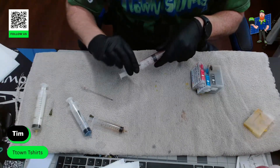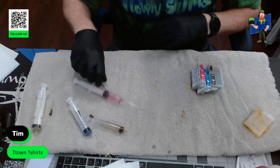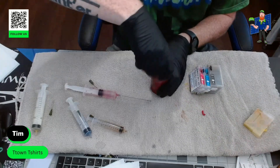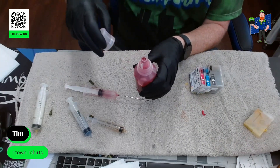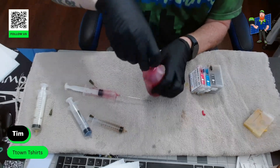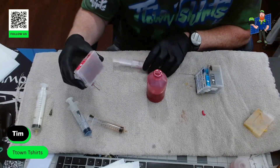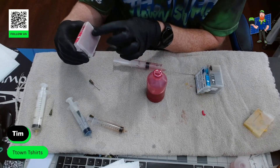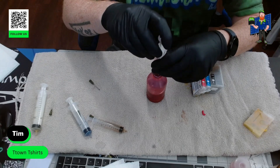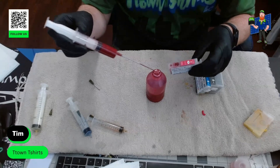I've got two different sizes of syringes. I'm not a fan of these small ones — for these bottles, you can't really get to the bottom. So I use these longer ones. Same thing: take the cap off to the side. There are two caps — if you wanted to fill it into an EcoTank you can use that. But fill from the bottom. We'll see how much we need on this one. I always fill up all of them — so that's a good idea. That's how much I need. I probably only need about 10 milliliters of this one, and this one's a little smaller so it's going to look like I took more out of it. That's why I like these long ones.